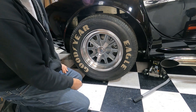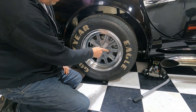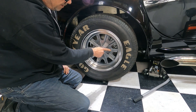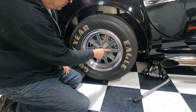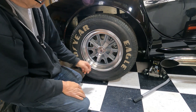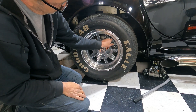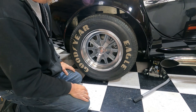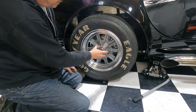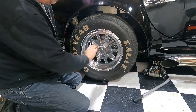If you want to safety wire these — which I'm going to, mostly for looks — I drilled a small hole in the end of one of the spinners and we'll safety wire to there. Remember, this one comes off toward the vehicle, so tighten toward the rear of the vehicle.